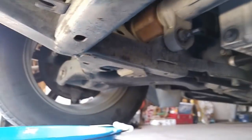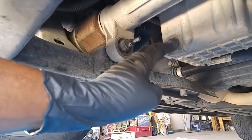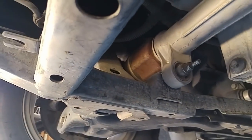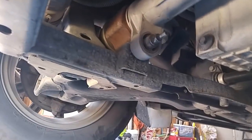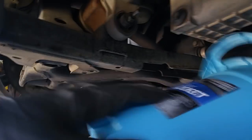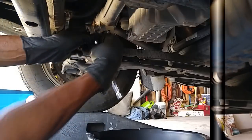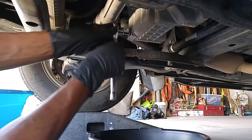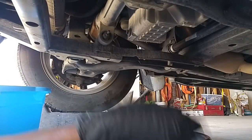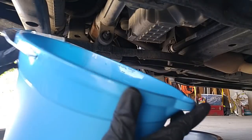The reason why I have two buckets is because when you take this drain plug out, the oil shoots out and it gets all over this little cross member. You can use cardboard or anything that will divert the oil down into your drain pan. I just take a separate bucket and hold it up like so. The drain plug is also a 13mm, so I'll go ahead and loosen it up and get my bucket in place — you'll see just what I mean how hard it shoots out.